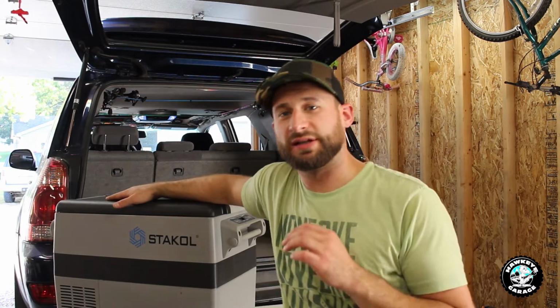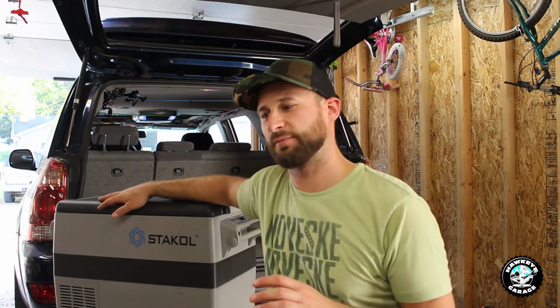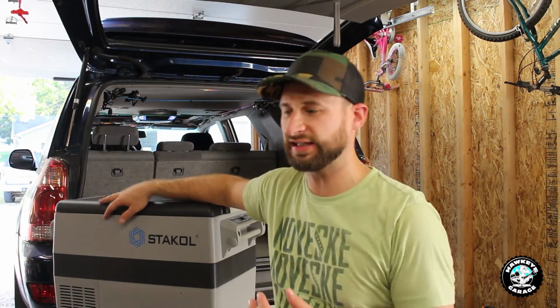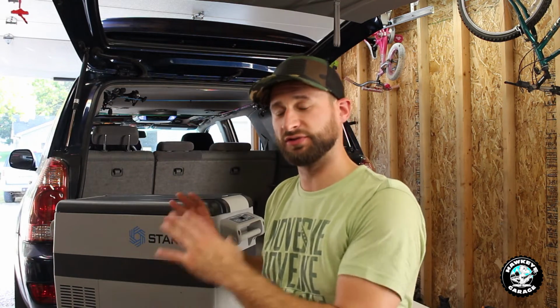This thing does take a few minutes to start up. I've talked about that before. From comments other people have made and other things that I have seen, that's fairly common. This is a refrigerator, so it uses a compressor that basically does the making of the cold, if you will. We're gonna dumb it down. And it has oil in it to lubricate all the internal parts. Now, just like the refrigerator in your house, a window air conditioning unit, a mini fridge, if you've picked it up and jostled it around, you should let it sit for several minutes, depending on how crazy you've been with it,